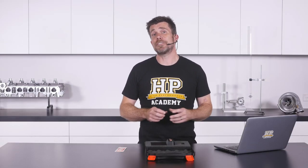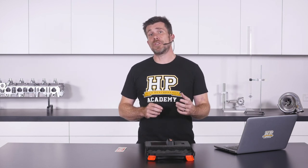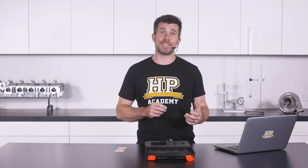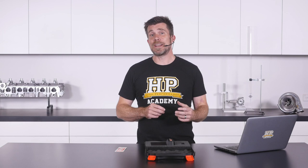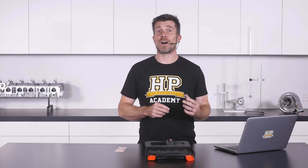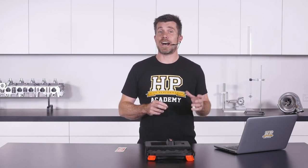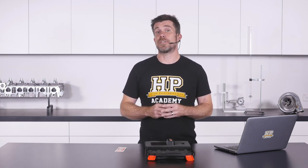When you're considering the purchase of an aftermarket ECU for your particular project, there are a mind-boggling array of options from manufacturers out there. Shopping on the basis of a feature set you're looking at on the internet can be a little misleading and confusing. What I'm basically saying is that not all ECUs and not all ECU functions work the same. Take knock control as an example — there are a variety of ECUs now providing knock control, but they're not all created equal. Some knock control strategies in other ECUs are very limited and basically all you can do is set a gain value and then adjust the background noise threshold to suit.